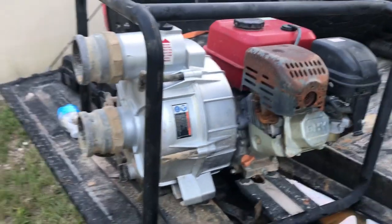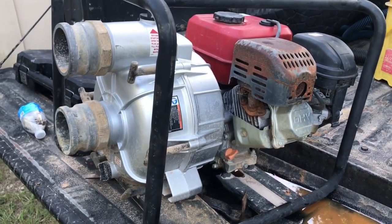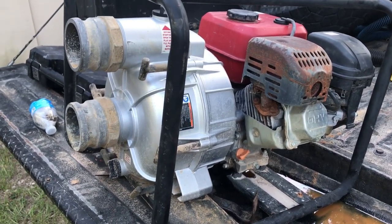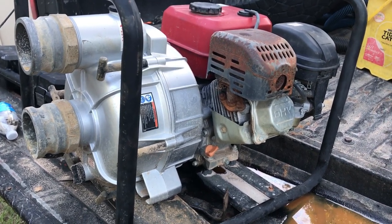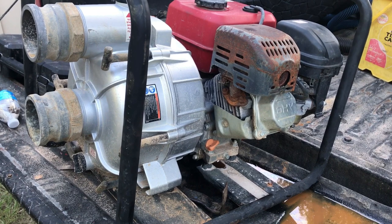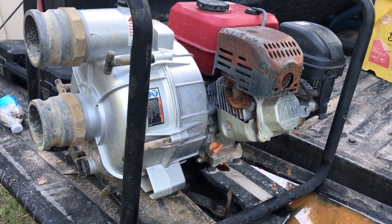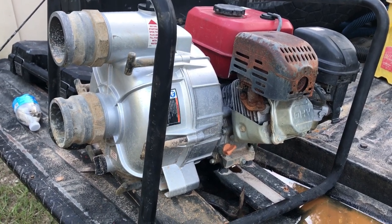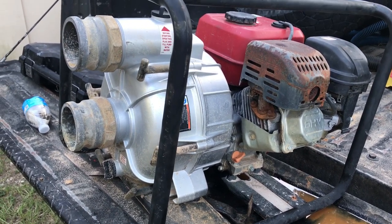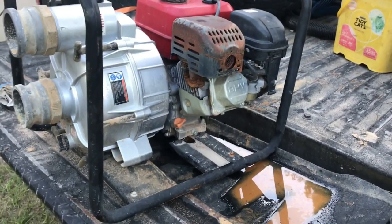Just the weight of the pipe wrench basically broke it over. I guess maybe the ring got a little scratch on the inside, but it broke over, and then I pulled it 10 times and it didn't want to lock up or scratch. I did top the oil off — it was a little low but not out of oil. I sprayed WD-40 down inside the spark plug hole so it'd get down inside the cylinder. Maybe it just got some weathering in there, like a sort of instantaneous rust — I don't know, because I didn't tear it all the way down to the cylinder.